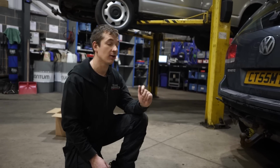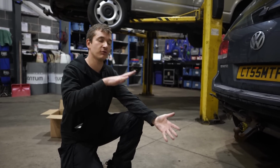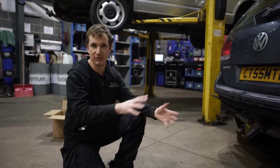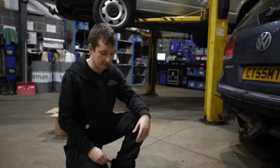That's next thing. The steering rack universal joint, we'd have to make that longer because you're moving the subframes away from the bodywork as such. Not like on a chassis car where everything's mounted to the chassis and you're just lifting the body up. This, you're sort of moving things away, so brake lines and stuff.